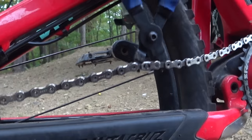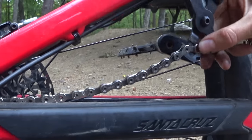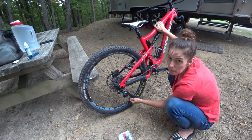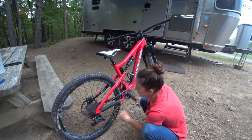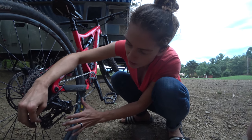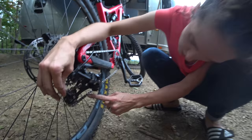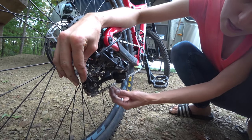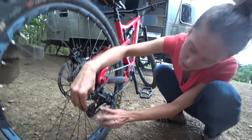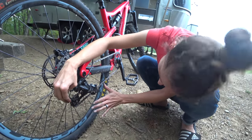I'm going to pull these apart and pop it in. Now I'm just going to pop that pin out. Just double-checking now that the chain is on here correctly to make sure it isn't still too long, and checking that nothing is rubbing. If it wasn't the right length, this would swing further up and the chain would start to rub things underneath. But everything looks good.